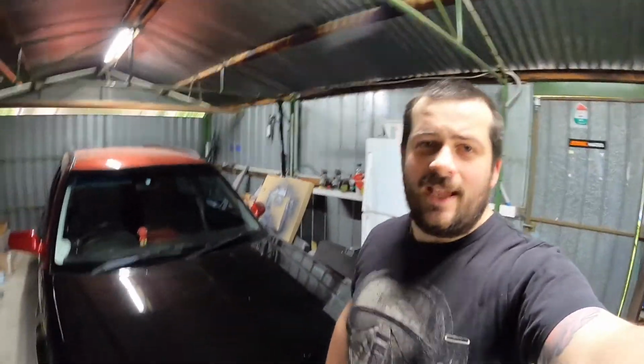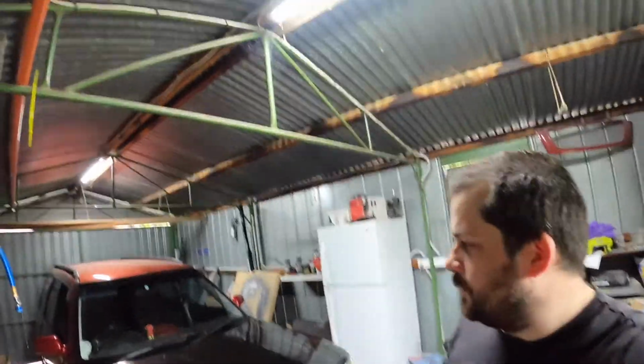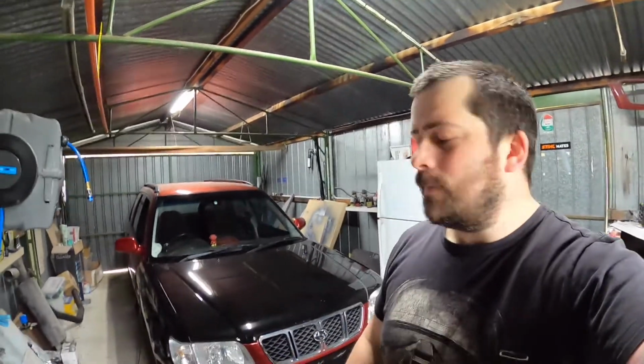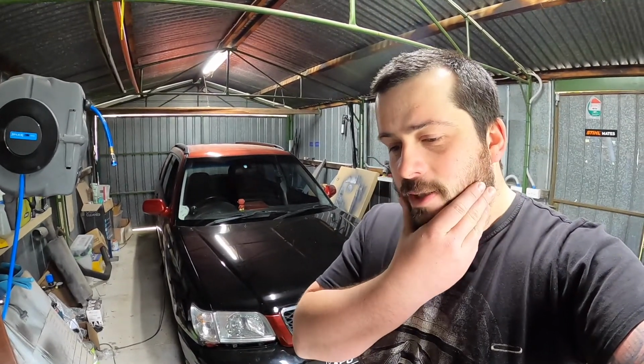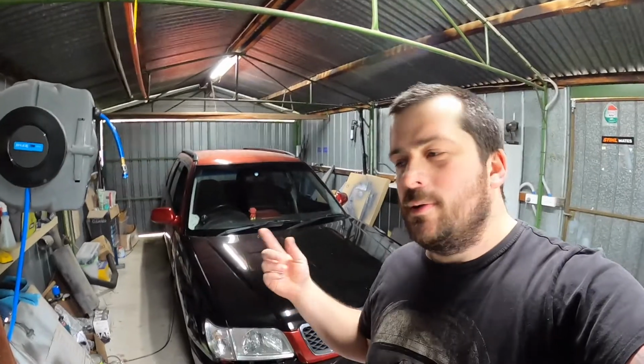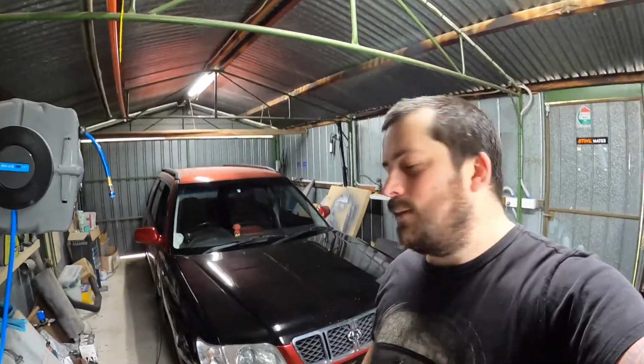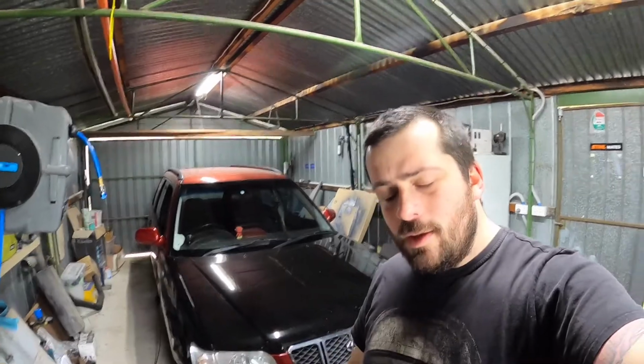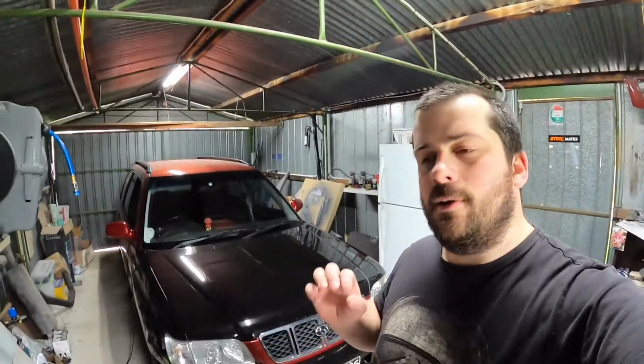Alrighty guys, it's the next day. Actually nearly ran out of petrol, so I couldn't really do much more tuning, but went and picked up some more last night, so I chucked that in. I realized I had something else in my histogram, so the numbers I was looking at weren't right, so I may have had it good and then changed it, so I had to start all over again. That doesn't matter, you're not going to see that until I finished it anyway. But I'm going to try to get as close as possible, and then I'll get into the load compensation table, because there's actually zeros all the way through that, so that should enable me to get close to 0 for the discrepancies in the fuel ratio.